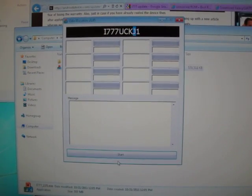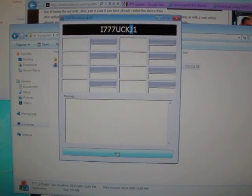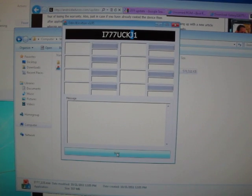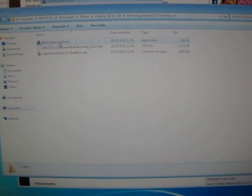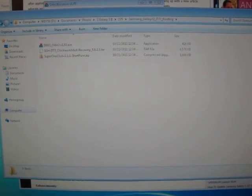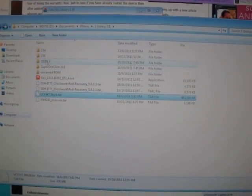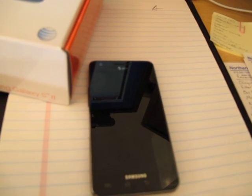After that, open the second executable which updates your Galaxy S2 from firmware H to J, meaning from 2.3.4 to 2.3.5. It's very simple — just open the executable and hit Start and it does everything for you. The first root flash only takes about 10 seconds; this one is larger since it installs a big file — the ROM is about 480MB and the exe is around 500MB — which converts your phone to a stock 2.3.5 build.